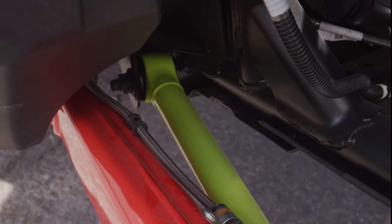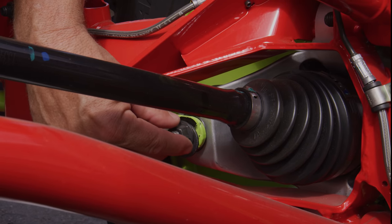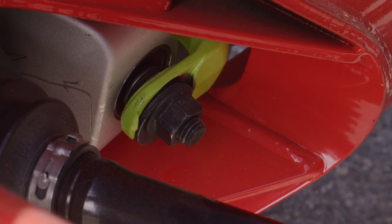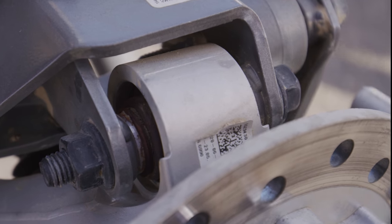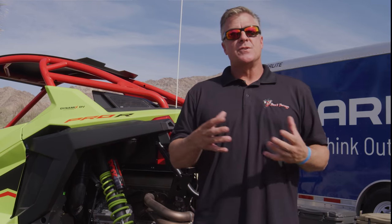Being a suspension guy, let's dive into the MaxLink rear suspension. You'll see a toe control link that extends from the front pivot point through the trailing arm to a pivoting hub. This is very adjustable — in the field or in racing, if you bent something, you could reach a tool straight through the wheel, grabbing one side of the toe link and adjust toe while the tire is still on the vehicle. Next to the toe link is a new unitized hub and bearing assembly that bolts to the aluminum spindle, allowing instant replacement without having to press a bearing in or out of the hub.